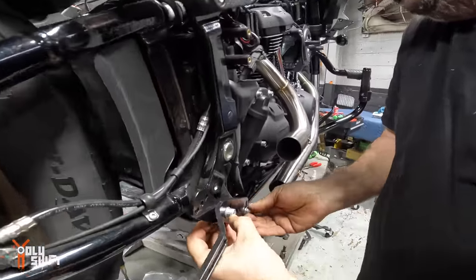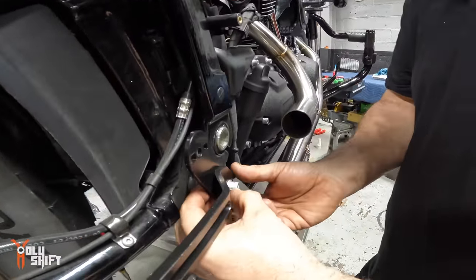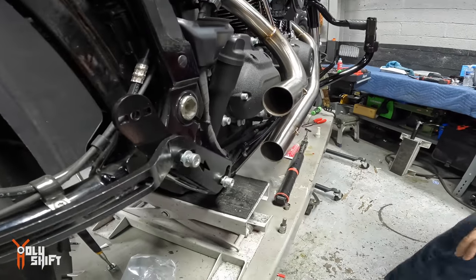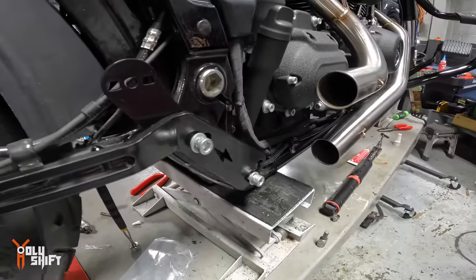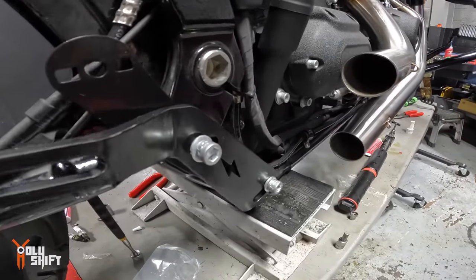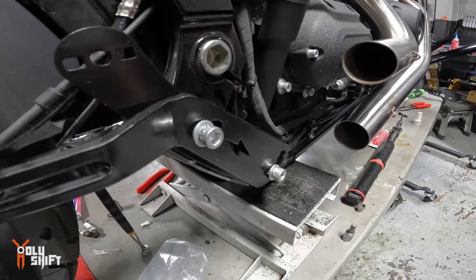Well, you put red. That means that pipe is never coming off, and I don't know about that. No. Well, red, it's not always what you think. Red Loctite is actually because of the bolt size. Gotcha. Blue Loctite will do nothing on a bolt that size. Oh, I got you. Look, it's got movement over here, so it can actually be...